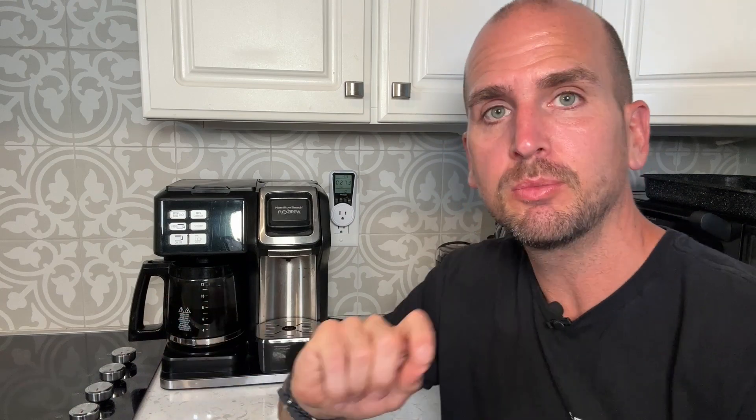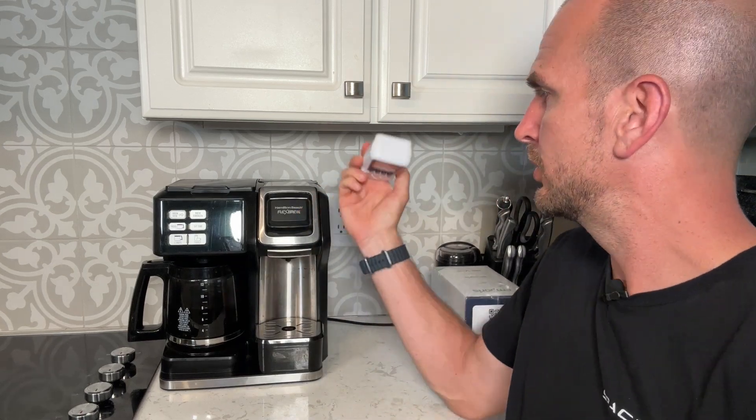The whole pot test is where the energy watt meter really shines — it took two hours total. Why? Your coffee machine goes through an initial cycle to warm up the water, sends it through the grounds, and makes your coffee. But then at the bottom there's a hot plate, and you'll hear a relay clicking on and off about every two minutes to keep the coffee warm — that lasts about two hours. The total energy consumption was 0.273 kilowatt hours. The single cup was 0.03, so we used about nine times the energy, made five times as much coffee, but the hot plate made energy consumption nine times higher. With a simple, inexpensive energy meter you can better understand your appliances and make smart decisions when designing your solar power system.